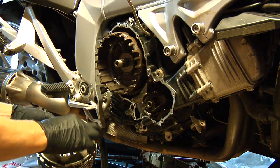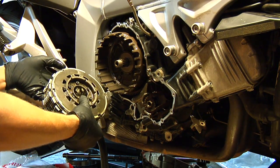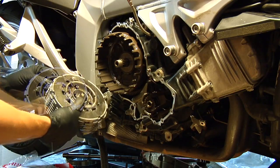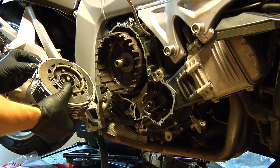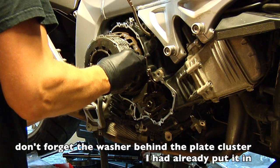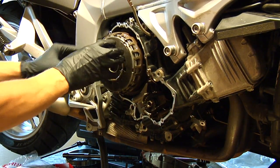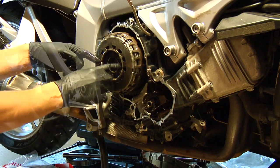Once you release the bolts here, this can go out of alignment, so you may want to install it and then torque these bolts here. So let's do that. Now my groove tabs are here and it's going in here. Once the clutch pack is in, you can hand tighten the bolts and then torque them to 8 Newton meters.